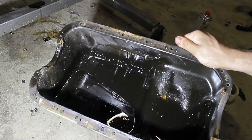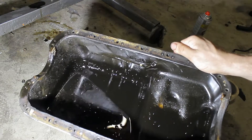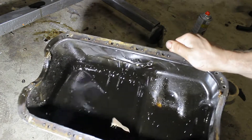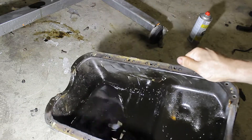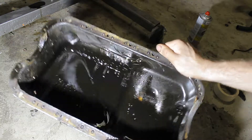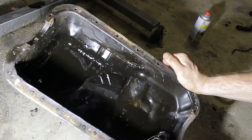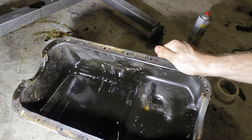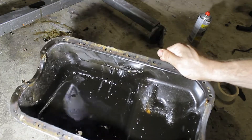I've just put a little bit of oil back into the sump, and I'm pretty sure that if you go racing, you know that your center of gravity changes and moves around if you corner really fast. Well, the same happens with the oil in your oil pan. If you corner real fast to the left and to the right, the oil will slush around in your oil pan. And if you are very unlucky, there won't be enough oil left for your oil pickup to actually pick up — and that will lead to oil starvation and some really nasty problems.